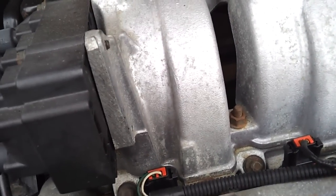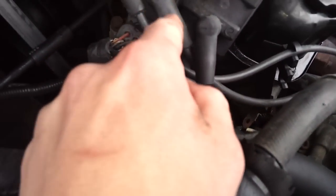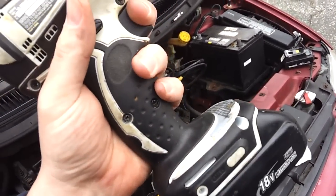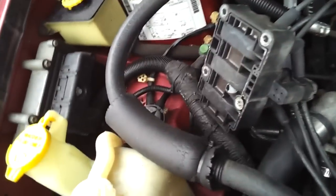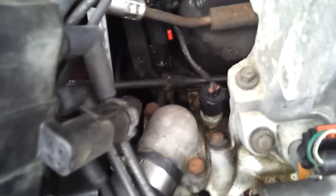You're going to want to tear this down — plenum first. Take your 10mm and take this off first. When you're taking down the coil pack, you're going to want to remove the number four spark plug. If you're using something like this — a Makita 18-volt electronic ratchet, really worth the 300 bucks — you're going to want to take that plug out because it's going to get in the way. With that pushed out of the way, these valve cover gaskets are so bad. Holy shit.